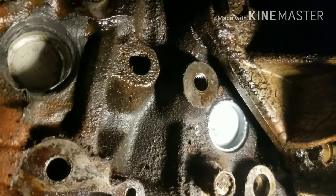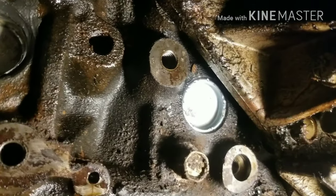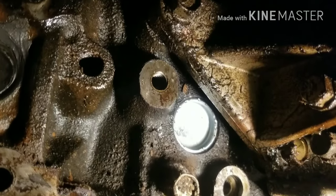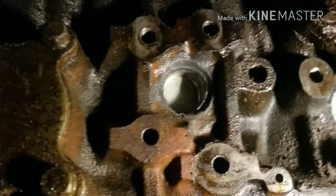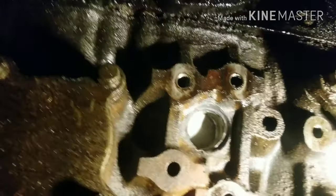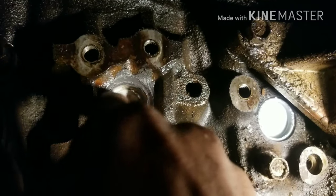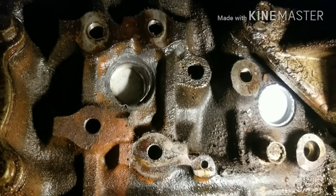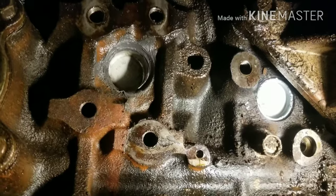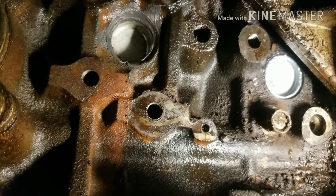All right, now we have the new freeze plug in here. I was going to use a little rubber plug, but because that's behind the cylinder there wasn't enough space, so we just went ahead and tapped that on in and put the new freeze plug in there. Someone did this freeze plug here, and you'll notice this freeze plug is recessed a lot more than this other one there — someone drove that in a little too deep, and that's why they have silicone around there. But you are supposed to install these freeze plugs dry. They press in and you just tap them in with a punch and a hammer if needed, but don't push too hard or they'll go right on through.